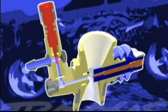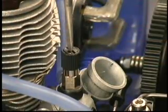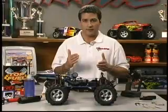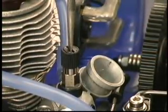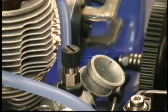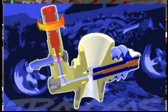The engine's performance is directly linked to the fuel mixture. Richening the fuel mixture increases the amount of fuel in the air-fuel mixture ratio, and leaning the fuel mixture decreases the amount of fuel in the air-fuel mixture ratio. Leaner fuel mixtures deliver stronger, more efficient combustion and more power. Richer fuel mixtures deliver cooler running and more lubrication, but less power.